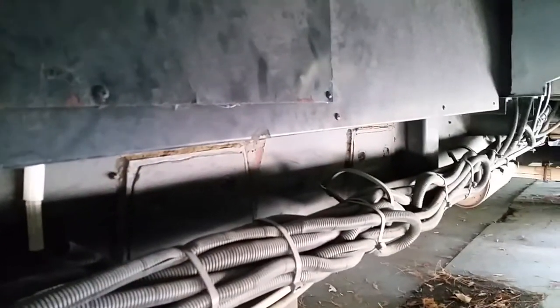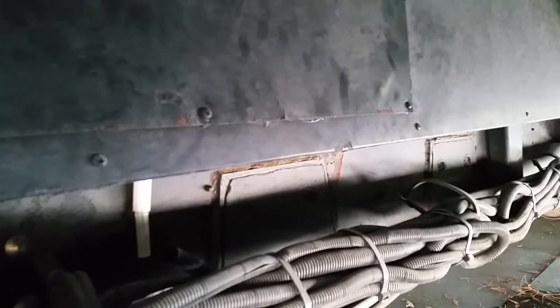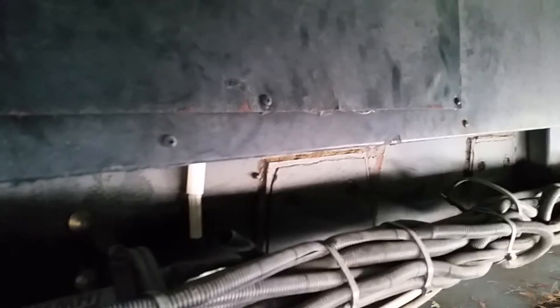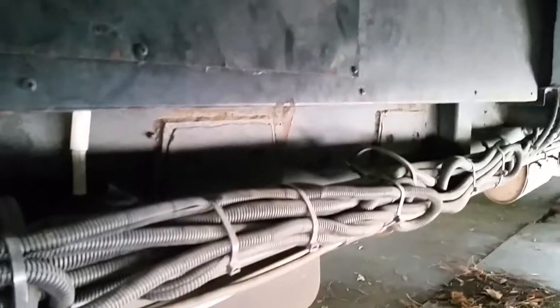Evidently in hydraulics, it can be kind of tricky when you got two cylinders pushing on an object, making sure it doesn't rack, like the room goes sideways in the hole. I think it's called racking. Everything gets jammed up. So you got to do something to make sure both cylinders move at the same rate, regardless of load. You may have something heavier on one side and it causes it to bind up or require more pressure. But the equalization cylinder takes care of that, because you got your input line here. This comes right off the pump. That's probably coming in at about 3,000 psi or so.